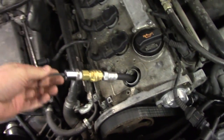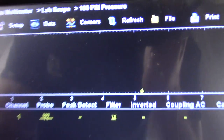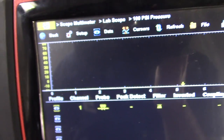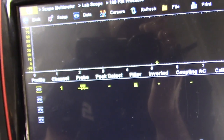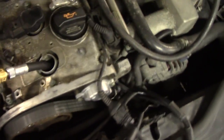I have a PV350 pressure transducer installed in cylinder number one. I just want to see if we can see anything. The only issue is that I am not sure how to calibrate it, so my scales are going to be off. But this should show me valve openings and closings — hopefully if there is an issue we should be able to see something. I am going to see if I can get this thing started up.